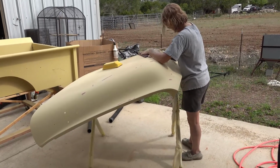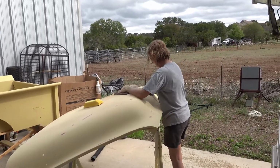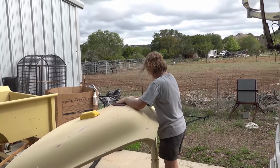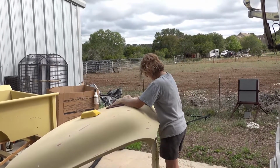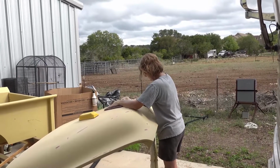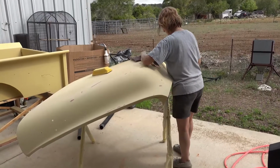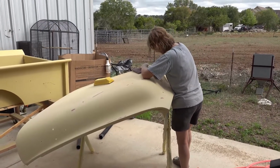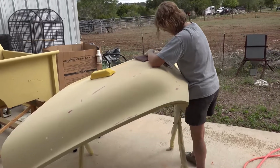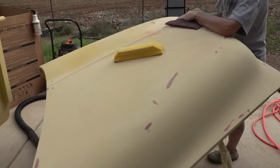So it's November 11th. We're kind of at the end of the week. Denise is working on the hood again. We had to reprime it after we did some more body fill to pick up some of the dents and the nicks. And I've got a little red putty on there to get it ready for top coat again. She's getting ready to leave to go up to top of Michigan to see her dad. But it's again coming out good. You know, second time is always a charm.